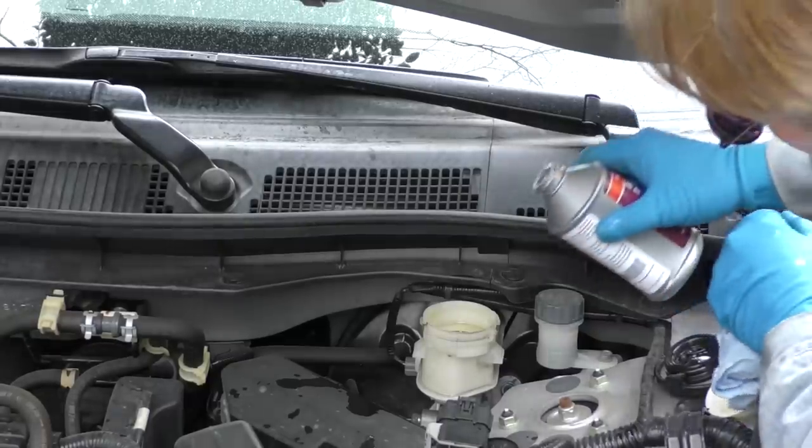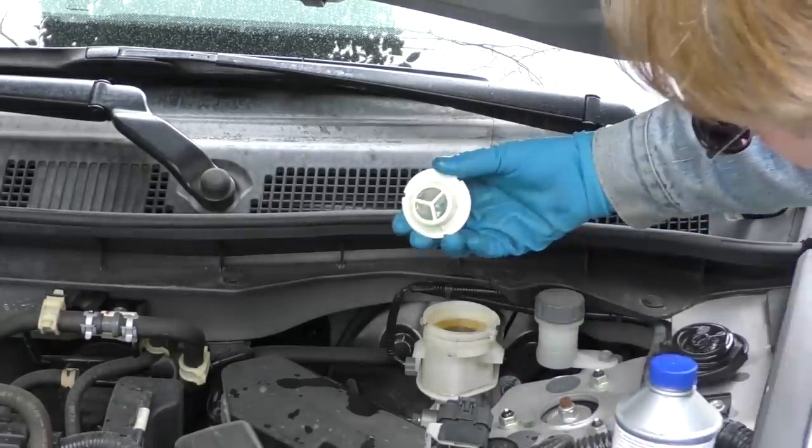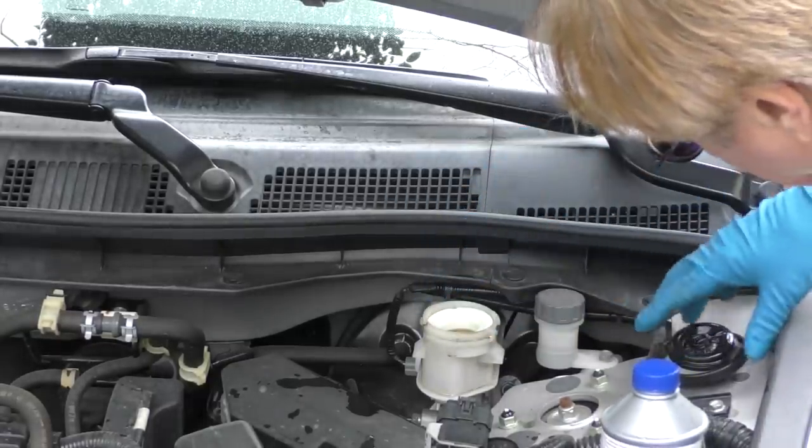Then of course, you fill it up. Put the filter screen back on and put the top on. You want to keep the system sealed as long as possible. You don't want to have it open while you're working, because then the water vapor comes in. Today it's kind of misty, rainy out today. You definitely want to keep it shut whenever possible.